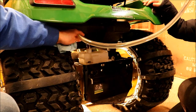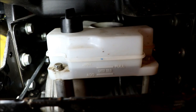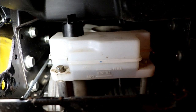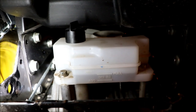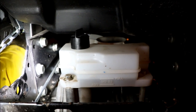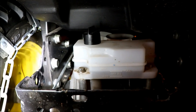We drove it around a bit, got the snowblower put on, and you can see it's still at the right level. We're not sure why the book and maintenance sheet call for more oil than what came out. It might be that's the capacity when completely disassembled during installation. We did have the lifting arms up all the way — maybe that's why it didn't use as much oil.